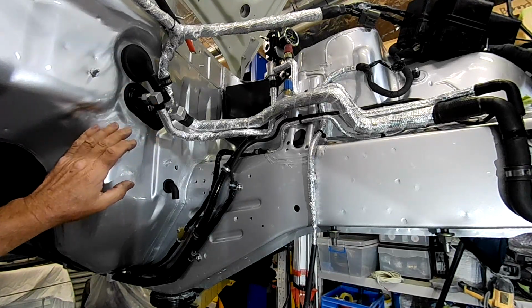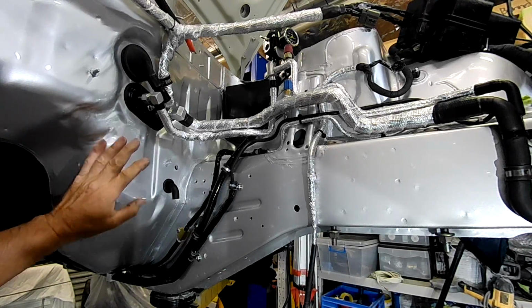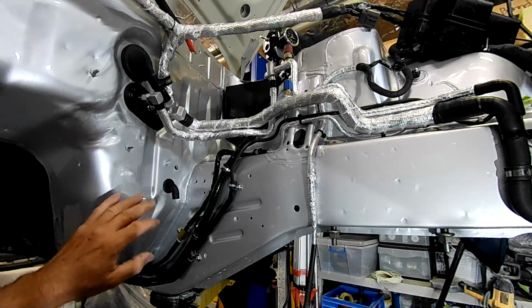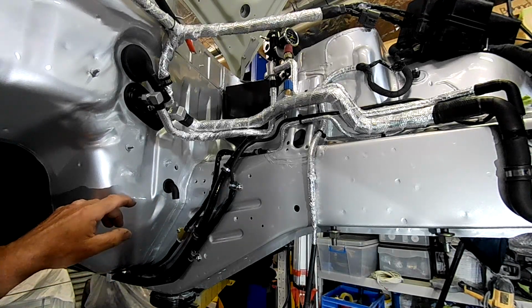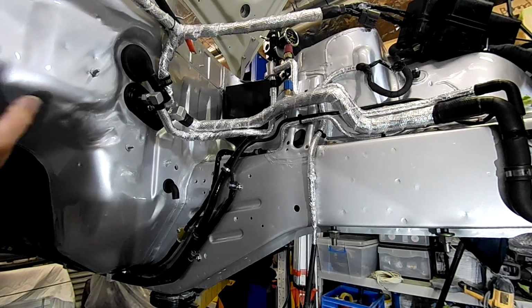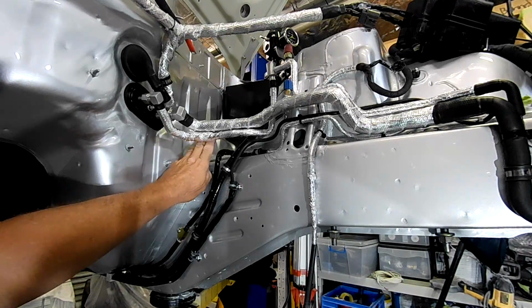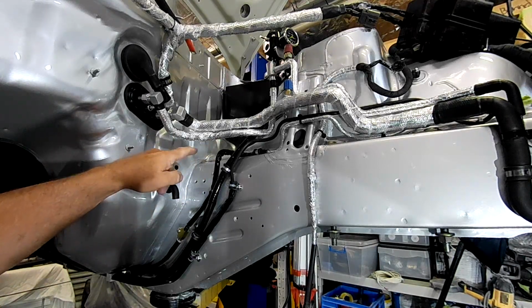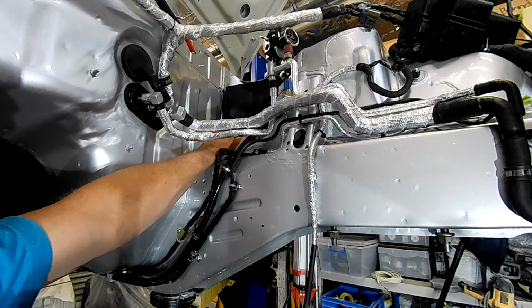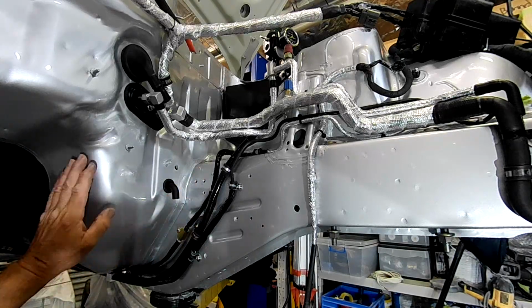There's also the O2 sensors, the two wideband O2 sensors that I'm using in combination with the Haltech ECU. They will go probably up and over the firewall here somewhere to keep them away from the heat. And they run through the battery mount bracket. There's a hole in that and a grommet that I've put through there, and then go down through the inner guard under the battery tray and back into the cabin in there and into the ECU.